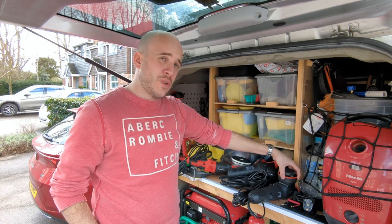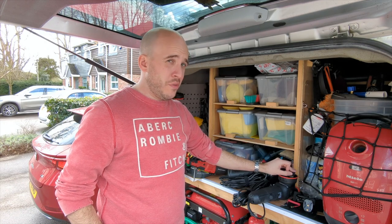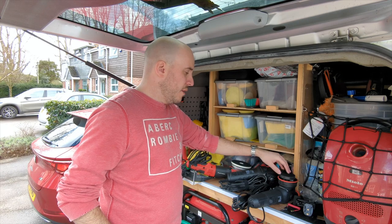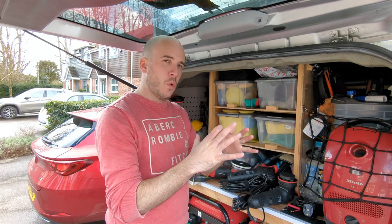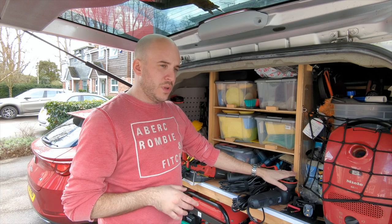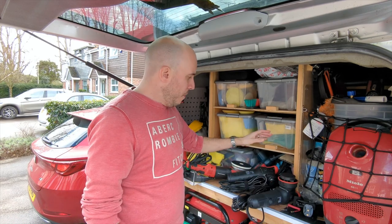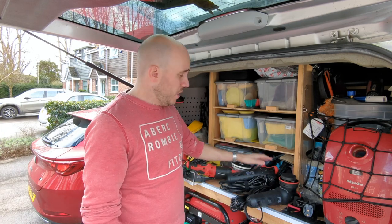Yes, it has a bigger shroud, but it's more powerful. With the 3-inch pads on, this felt way more stable, especially with the Rupes ones, which are slightly flared; this backing plate filled up more of them. That was good, so I got more even pressure across them. It was torquier, it didn't stall out, I felt I had really good control, not vibey at all. It felt more enjoyable to use. It's not much bigger than this, as you saw.